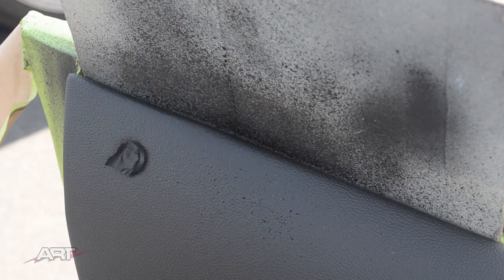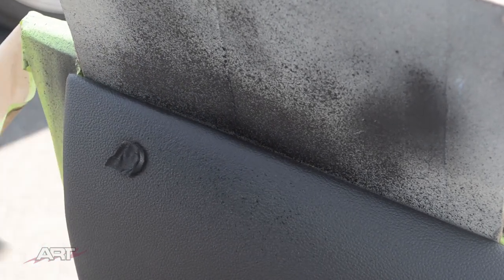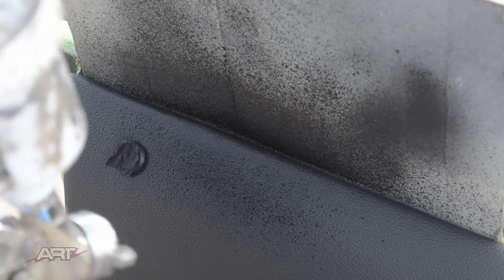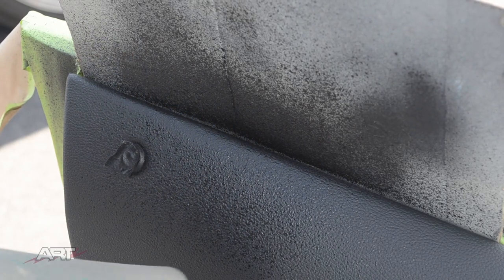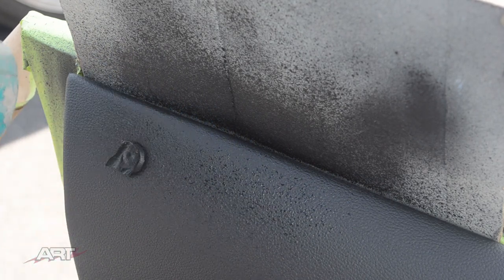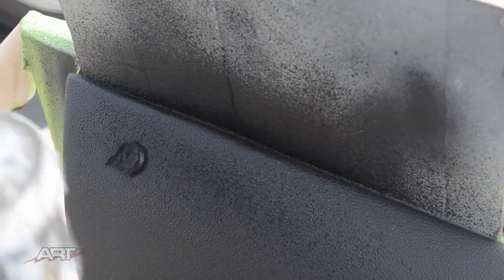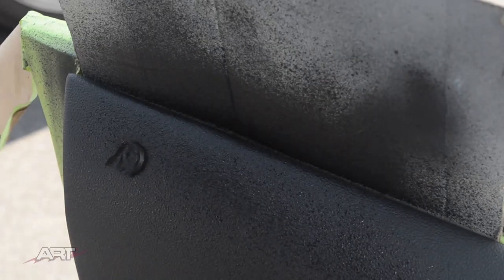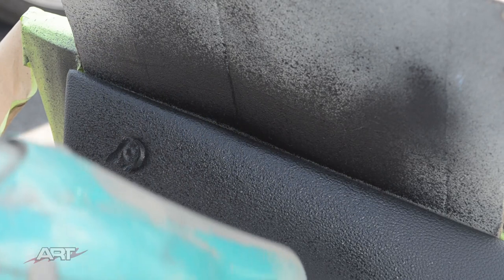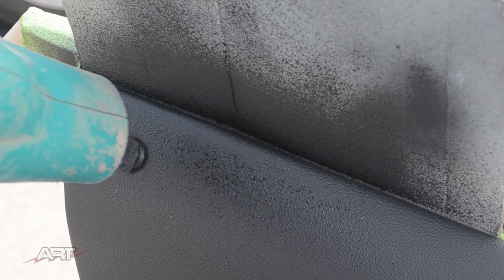So, if there is one takeaway from this video, I hope that it helps you to see how to construct a texture. Use a water-based spray that is strong enough to stand up tall, even when sanded. Use the HVLP touch-up gun to dial the size texture you want by regulating the air pressure. Sand down the big textures to half their height. A medium-sized texture on top of that can give you the diversity of hills and valleys to give you that randomness that disguises your repair. The final light texture can be left rounded.